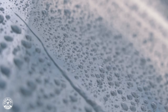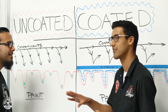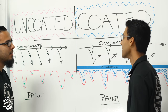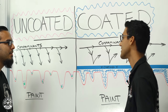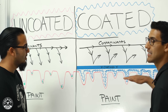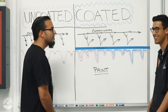So over here there's a diagram — why don't you explain what we're depicting here? We have two different situations: an uncoated car on the left and a coated car on the right. If we were to look at your paint really closely with a microscope, you'd see that the paint is actually really uneven at a microscopic level. What happens is when you're driving around or just sitting on the street, contaminants and pollutants fall into those little pores of the paint and get stuck there. When they get stuck there, they dull the shine, bond with the paint, and could even cause rust. To avoid that, we put on a ceramic coating — represented by the blue line in the diagram — which evens out the surface so it's smooth, and contaminants, dirt, and debris just slide right off. Like a skier going down a mountain.